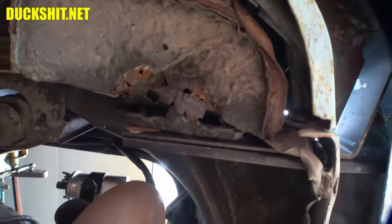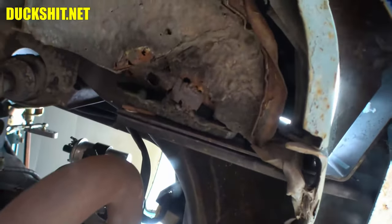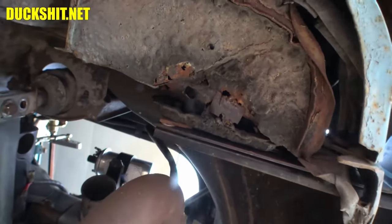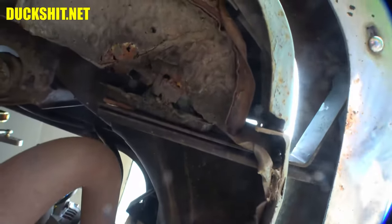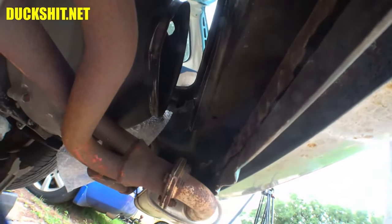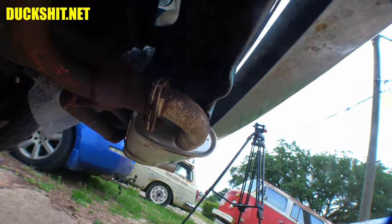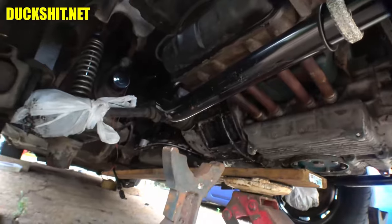While we're under here, look at that — I didn't expect to see that underneath this beautiful car. This is its little skeleton in the closet. When I push on the rear bumper — yeah, that is going to become a future issue. I'll have to let the owner know. That's the only rust of any significance I found on this car. There might be a little surface rust on suspension components, but that's the only real body rust. Also, this rear valence has two layers — this is metal and this is fiberglass. Somebody replaced it and glassed it all in, so it's not original. A lot of the body parts on this car are probably not original — this thing is rebuilt from all kinds of stuff, just grafted together. Beautiful car though, I would rock and roll this thing.